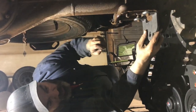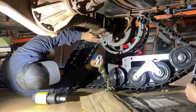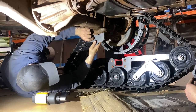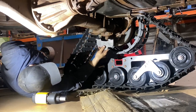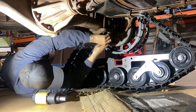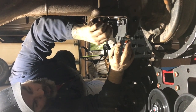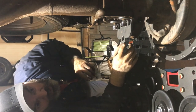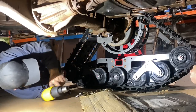We like to orient the bracket so that the hole the clevis or safety quick link is going to go in is closest to the track. We don't want it on the far side, because the chains are going to pull more on an angle rather than straight on — we want the chains to pull as straight on as possible. So we're going to turn it this way and then start our nuts on. This is the only part of the tracks where we don't supply the fasteners. Everything else we give you — we have a book that tells us which wheel nut goes on which vehicle for which year — but suspension components get a little muddy.